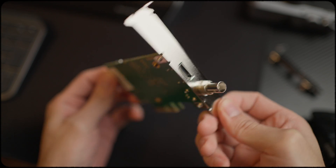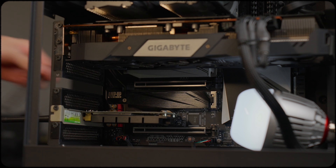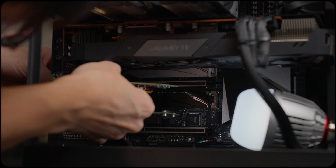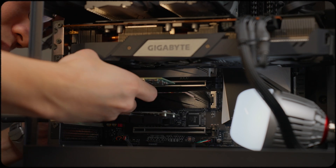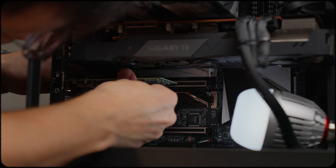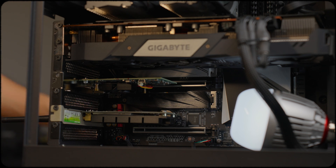In order to use it, if you're someone like me who hasn't opened up a PC before, you have to ensure that your PC has a PCIe slot that is accessible and empty so that you can insert the Decklink card. What you should do is just remove the cage on the outside and then insert the Decklink card into the PCIe slot. You can see that the fan is facing downwards — that's the proper way of installing it. It took me a bit of time to slot it in because I didn't want to break the card, but it takes about 5 minutes. Then you just screw back the screw and you're done.